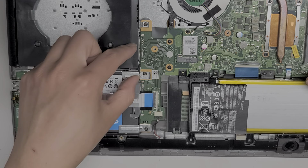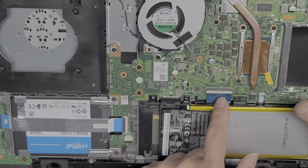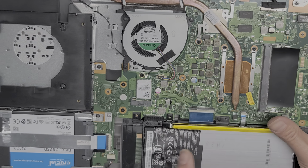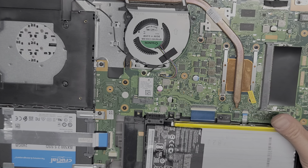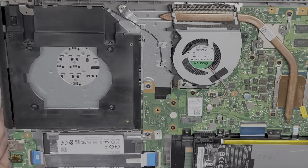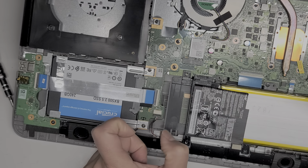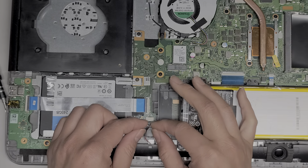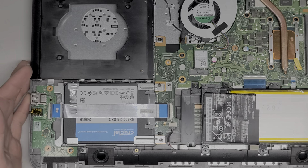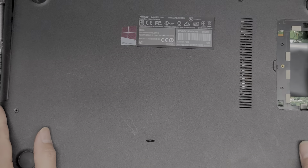This part of the board is replaceable — if you remove all the screws, you can actually pop this straight up. There's the CD bracket but it's not being used. Then you've got the keyboard connector here, this is probably the trackpad connector, and then the LVDS connector. If you mess with this screen connector, make sure you disconnect the battery, pull the battery out, and press and hold the power button for 10 to 15 seconds before you even move this cable — otherwise you can fry the backlight circuit. There's also the speaker bar down here; these connectors you just grab and wiggle as you pull, using your fingernails on the edges. That's pretty much all there is to this.